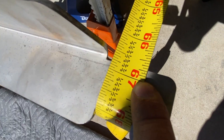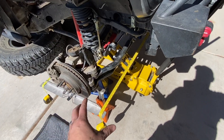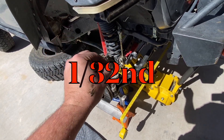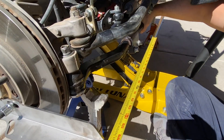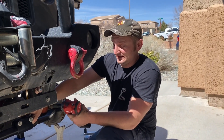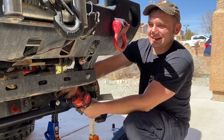Drape over your tape measures. We're at 66 and about three quarters on this side, and back here we're at 73 and a quarter. It's a lot tighter on this end and a lot wider on that end, so we're going to need to bring this out. Typically 1/32nd of an inch is what you want to be toed out or in — depends on what your preference is. After getting the toe set, I suggest tightening down your clamps next, just so it doesn't move as you go through and torque everything. You don't have to torque it all the way down, just tighten it so it's not going to move on you.